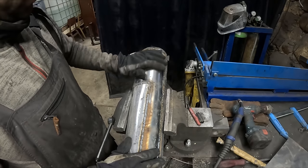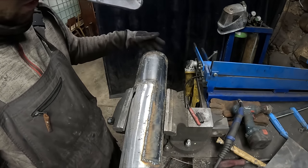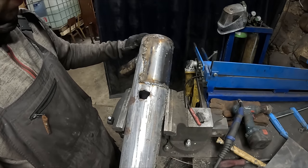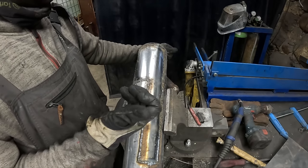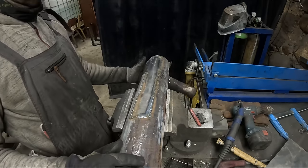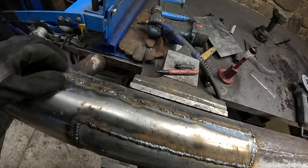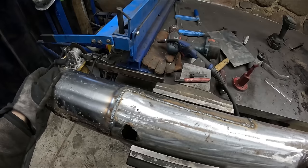It was quite interesting. I would say maybe 70% of the time it was smooth riding. But down there, I just kept punching holes in the thing. The moment I pressed the trigger, there was a hole in it. I tried the minimal setting, which was like 50 something. The thing wouldn't even work. So 60 something amps. Managed to patch this hole.